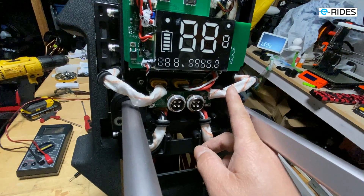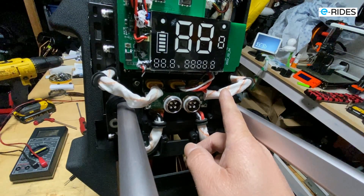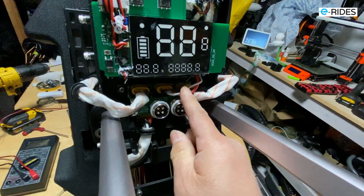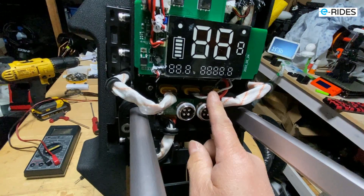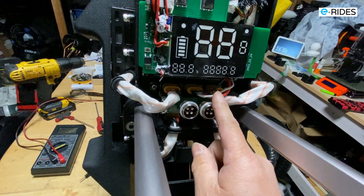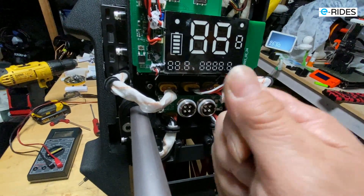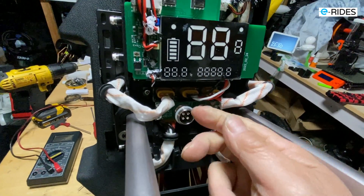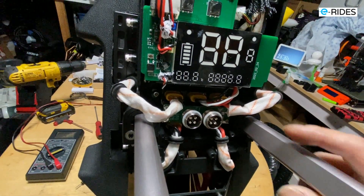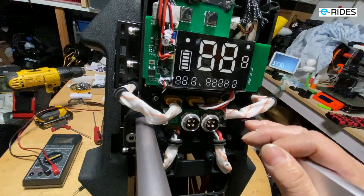It's a nice fast wheel, but if any battery pack fails, the wheel will drop because there's no redundancy — not like the EXN or the HERO, where each pack is the true power. The EXN has three packs of 100 volts, so if you disconnect two packs that single pack will still work — the redundancies are there. With the master there's no redundancy, so the whole wheel runs on one combined pack. If any pack fails, the wheel will fail.